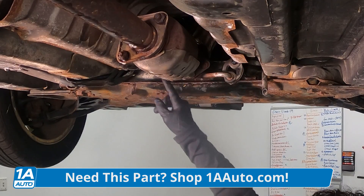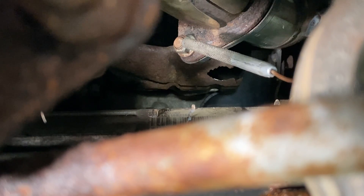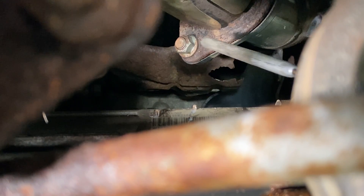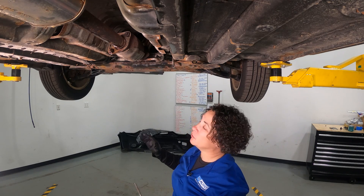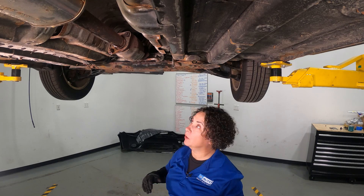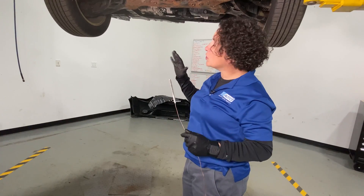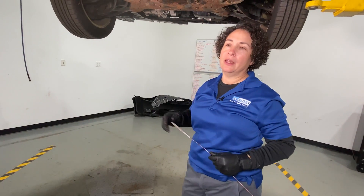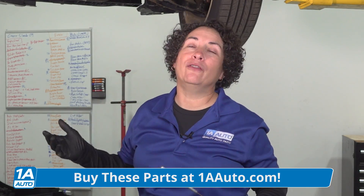You've got two nuts right here, a rubber hanger, and then one that goes up at the flange to the manifold pipe — just two nuts on it, very easy. As a pro doing this on my back I could do it in half an hour; at home with some knowledge, an hour easily. Think about the money you save buying the part and doing this yourself.